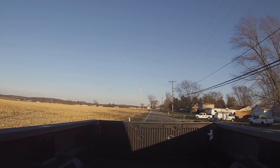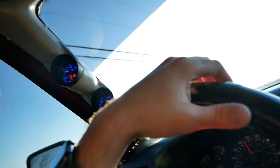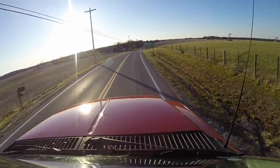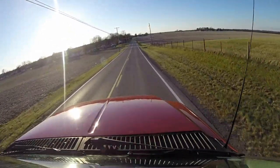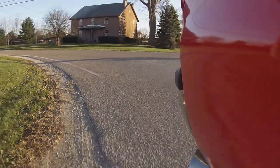Another upgrade I'm going to be looking at is upgrading the suspension. I'm not entirely sure how well it comes through in the video, but this thing rides really, really rough — way rougher than it should. It's not independent front suspension, so I understand, but I definitely want to upgrade the suspension and get some new shocks. The no-name spray painted shocks that are on it just aren't really doing it. Another note is the steering — we can see we're going straight and there's a lot of play, and that is because the steering is worn out. Whatever that was, we need to fix that — I think it has to do with suspension components, and it really didn't feel nice.